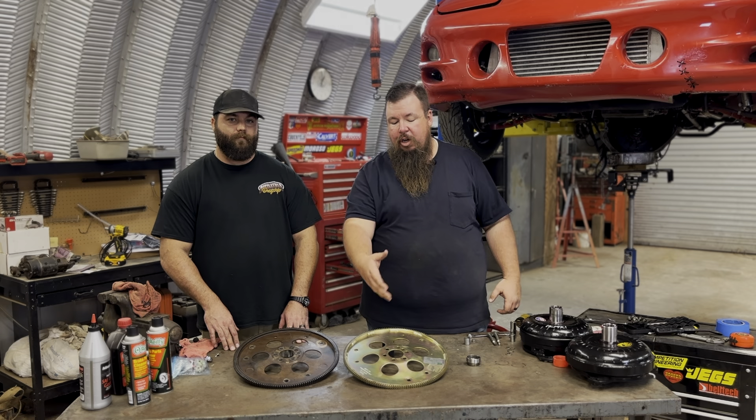You talk about a car in the high horsepower range — above 500 up to a thousand horsepower like this car — launching off the trans brake. We've all seen the videos of folks coming off the trans brake and blowing torque converters up, blowing flex plates up. That's a bad explosion and it can be very dangerous or deadly. We have a dangerous enough game playing racing anyways, so we might as well try to be as safe as we can. SFI approved flex plates like this — for a hundred dollars, that sure is cheaper than a hospital bill and trying to rebuild a car.